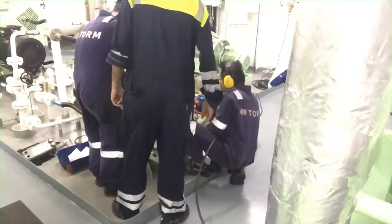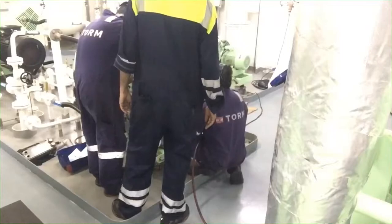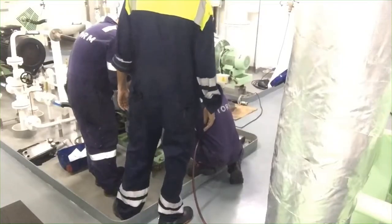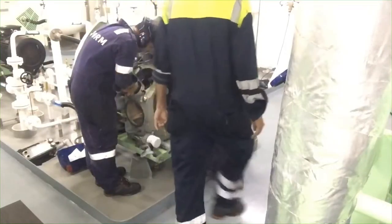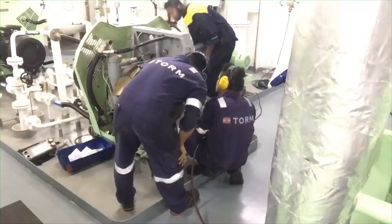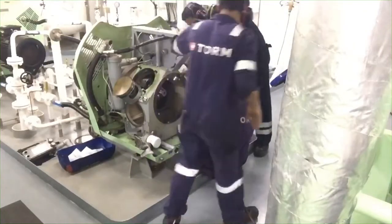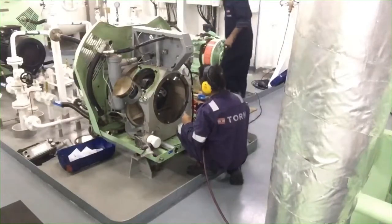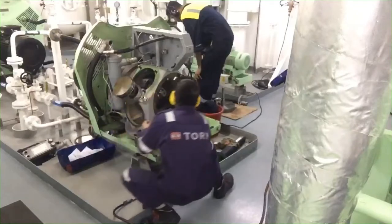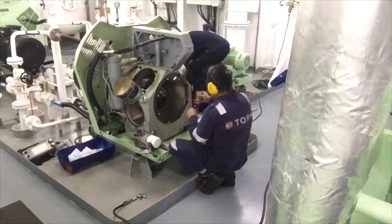This kind of compressor, the SPERRE compressor, is different from Tanabe or other compressors. The Tanabe compressor has a half connecting rod with a shell type bearing, but here in SPERRE it is cylindrical bearings in a rectangular position. I don't know how to pull this one. This is a roller, it seems like a roller bearing.